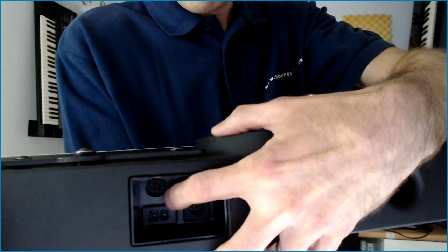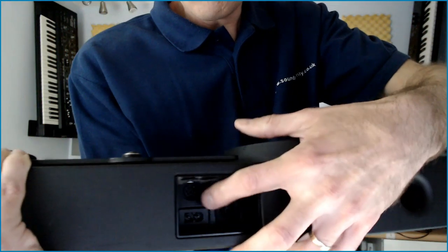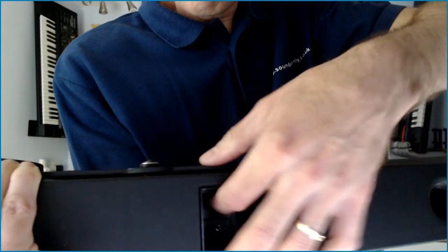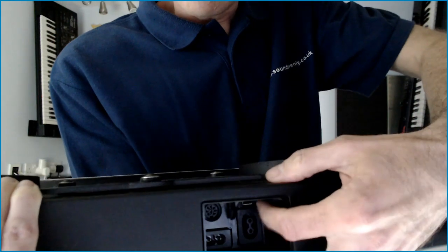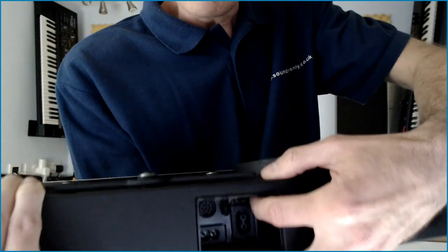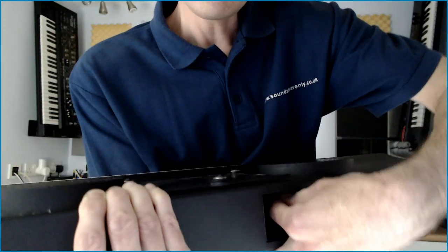Up in the top corner, just up here, we have the 8-pin DIN power link socket, which is the only audio input. And if you run your finger along the flat upper side of this alcove, just above the vertical power socket, there is a small rubber grommet. It's almost impossible to find unless you have very good fingernails. But if you have any problems getting the speaker working, or want to find out whether it's working when you first connect it, use either a long fingernail or a small screwdriver and gently pick out that grommet.